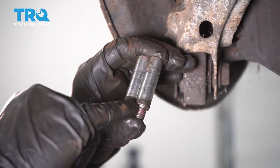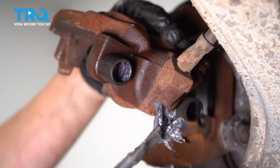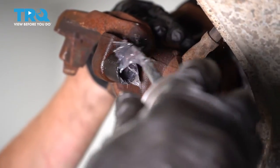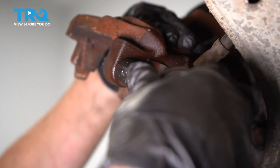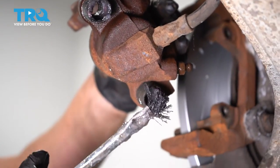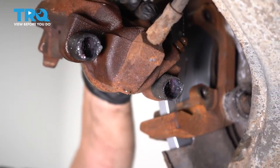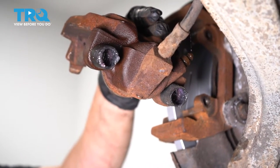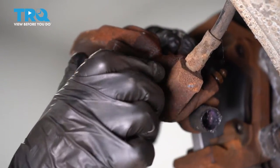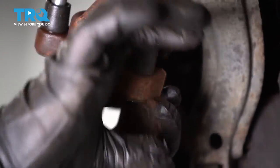These are the slide pins — I want to get all the gunk off and clean the threads, so I'm taking them to the electric wire brush. Put silicone paste or dielectric grease inside the caliper boots, right inside, so the sliders have something good to glide on — it's waterproof. You can also use caliper grease. Do both boots, make sure it's all nice and sealed. Inspect those boots to confirm none are torn. Then take the cleaned pins and guide them right in until the thread comes through on the other side.